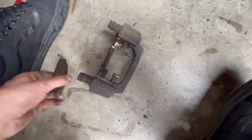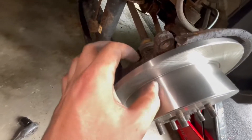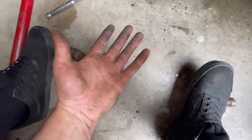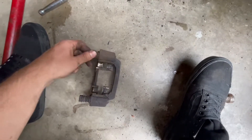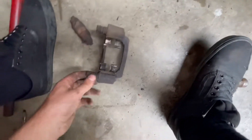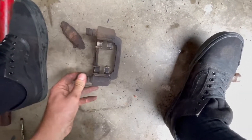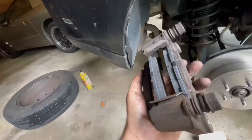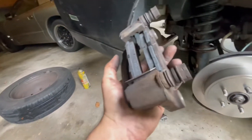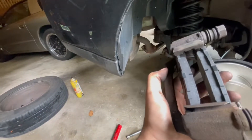When you put it together, you want enough space so that the rotor can fit in between the pads. I'll show you once it's assembled. If you want to wear gloves to keep your hands clean, that's a good idea — my hands sweat badly in gloves so I don't wear them. If you have grease, definitely grease up the pins. Mine spin really nice so I'll leave them alone. Also, in some sets of pads only one pad will have the tongue — theoretically your brakes wear symmetrically, so if that side is bad the other side should be bad too.